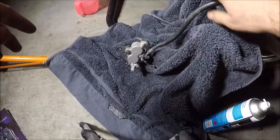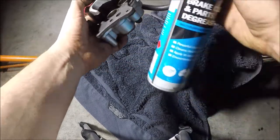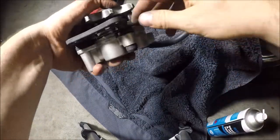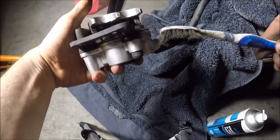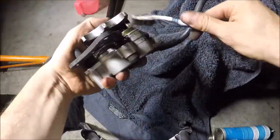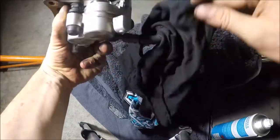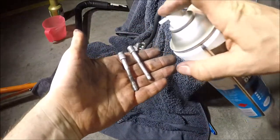I've put a towel down to protect the tyre and the wheel. I'm just going to use some brake cleaner to spray inside and clean around all of the pistons, clean the spring plate at the bottom. I'll use a toothbrush and some rag. Also take the time to clean your pins.